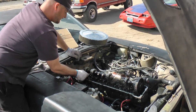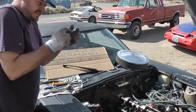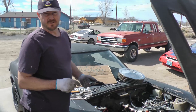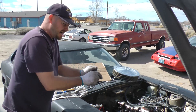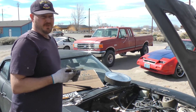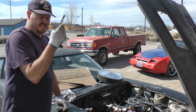Just finished the last adjustment — intake on number six. It just has to be just snug, not really tight, not really loose. That's what you do with every intake and exhaust valve. Save yourself about $180, because most shops will take an hour to an hour and a half to do this. It takes a lot of time and persistence, and you have to be dead on with your measurements because they are solid lifters — there's no play, no give. Your engine will run like crap if you don't do it. You will lose compression if your valves don't perfectly seat.